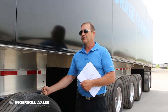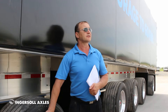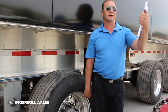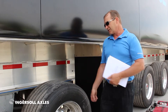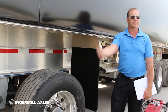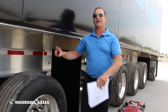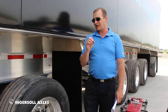So these things should have the tires balanced. If you can get them balanced, great — but for sure, make sure they're mounted on the rims correctly. A lot of times with roadside repairs, they'll try and get them mounted when still vertical and the tire seats low on one end and high on the other. It runs like a frigging egg going down the road. You ever get a guy doing a roadside on one of your units, bring it in right away and spin that tire — see what it's doing, because it doesn't take long to wear it out of round.